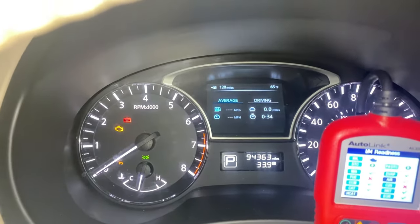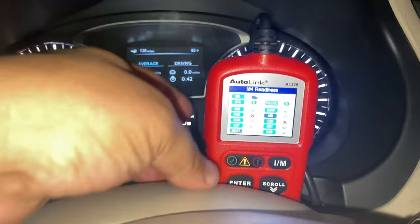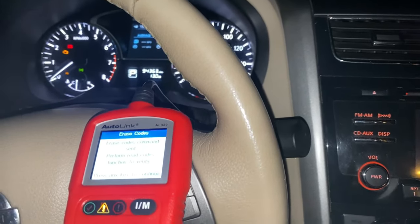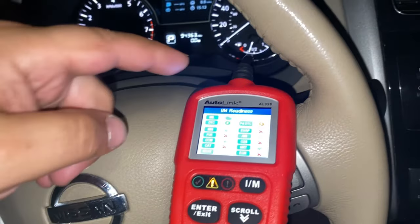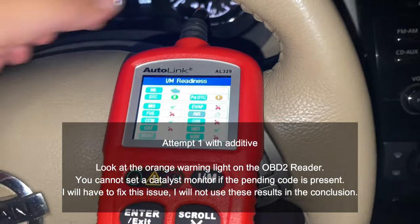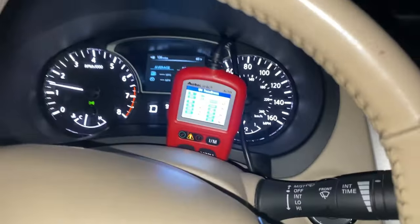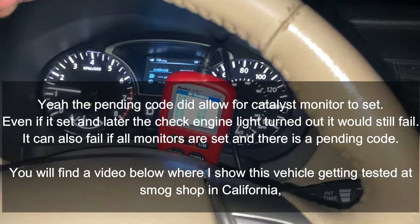Since the gas station we drove a few more miles — about 13 miles total. I already reset the fuel economy and we're going to reset the drive monitors. In about three hours, just like I did last time, I'm going to let the vehicle sit, start it, let it idle for 10 minutes, then take the same exact drive. On the second run there's a pending code — a P0101 for the mass airflow sensor — which was not there last time. The only thing different now is the Dura Lube catalyst treatment.